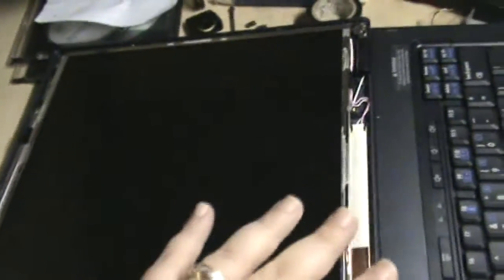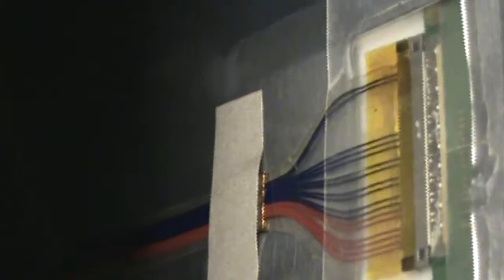I'm going to separate this from the inverter, from the Wi-Fi, and from the power and video connections to the laptop, take out the screen, and swap it in. Now with the relevant internal screws and side screws removed — two on either side, cleverly hidden by a plastic cover — we can lift and see the back connections for the LCD. I'm going to disconnect these and take this baby out.